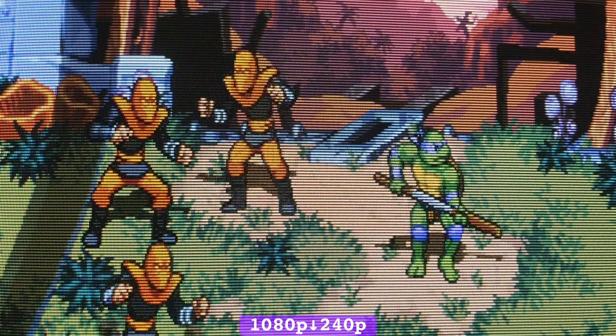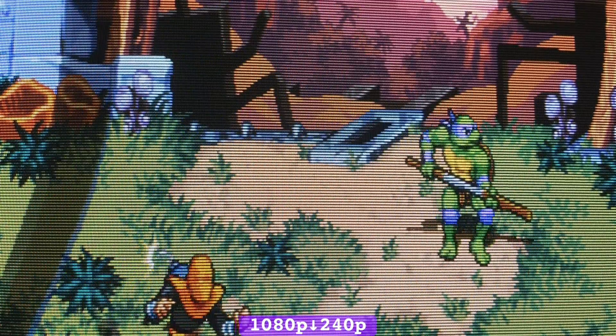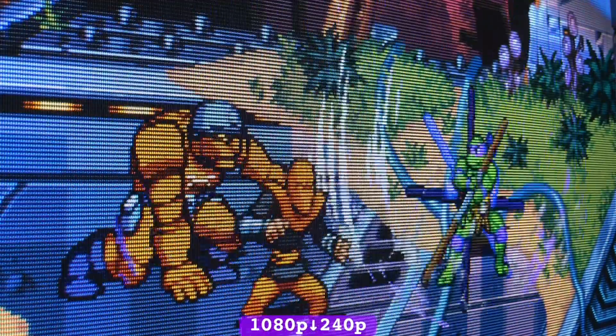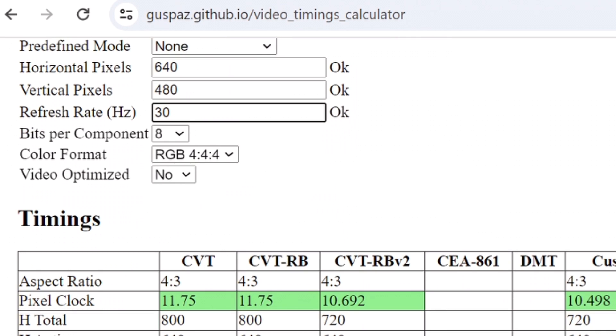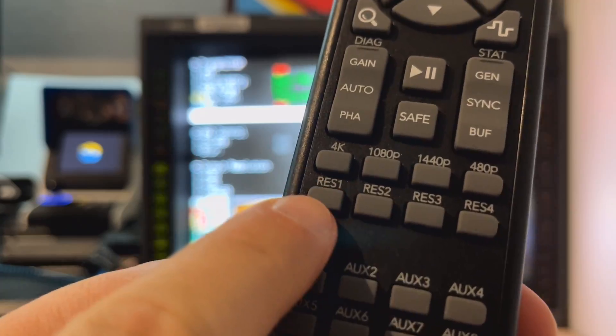270p assets, however, are a different story. Shredder's Revenge on the Nintendo Switch outputs in 1080p, and downscaled to 240 will never really look correct unless you downscale to 270p instead. I tried to make a 270-55Hz mode line but it was a non-starter. I also had a go at fooling the Tink 4K into outputting 480i by adding 480 vertical pixels at 30Hz in the mode line, which should equate to 15kHz, but again I was not successful. And what a shame, because decimating non-integer upscaled games is ultra-lossy.